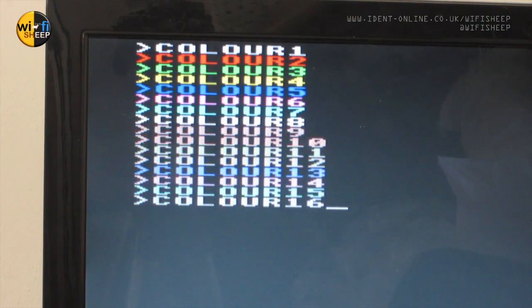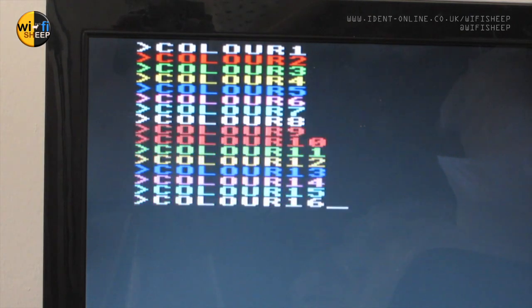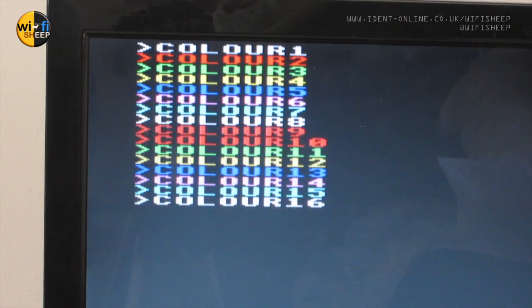The BBC Micro was a very capable graphics machine, but there was one element that seriously let it down. What you're looking at here is the entire colour palette that the stock BBC Micro could actually produce. Although it was boasted as being a 16-colour machine, it was only capable of generating eight unique colours at any one time, including black and white. The additional eight were simply flashing colours, and the colour choice was not brilliant — all games or graphics had to use this particular colour palette.